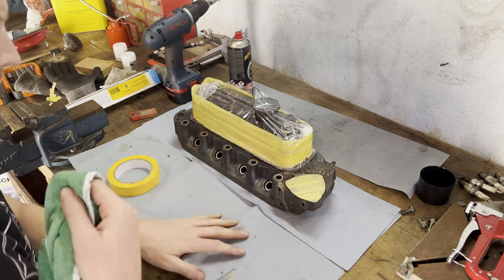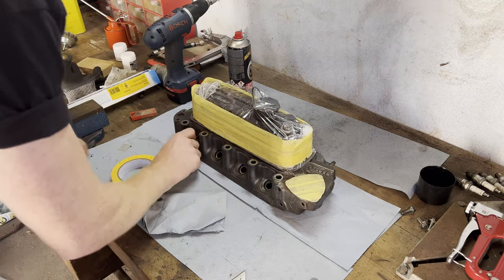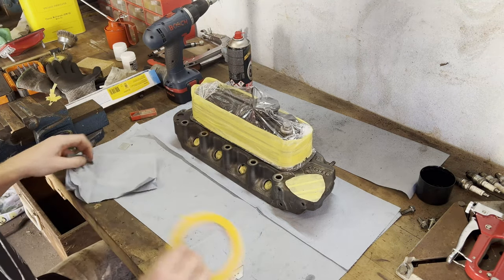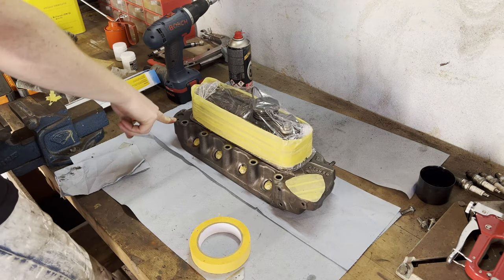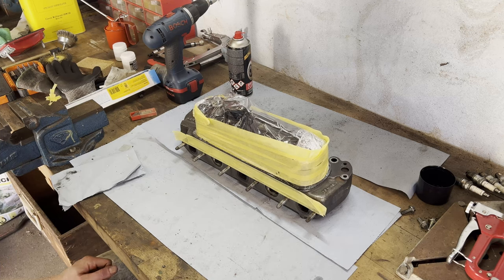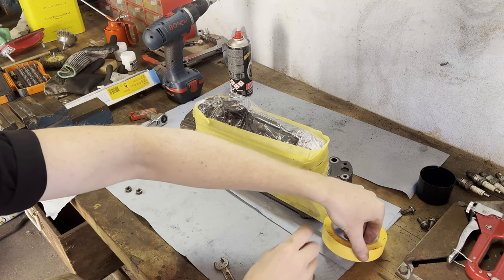How am I going to mask those spark plug holes? I'm going to use these — they're actually from this seat which I'm sitting on right now. That's four. This is for the alternator bracket — that doesn't have to be masked off. This is for the cylinder head studs. This is for the vacuum line bracket. I can still mask off the manifolds. It would have been handier to remove the studs — I'll remove the studs anyway. So that's the studs removed, now we can mask this off properly, grabbing our German razor blade again.